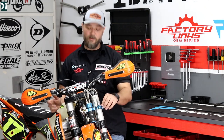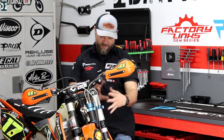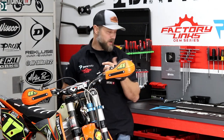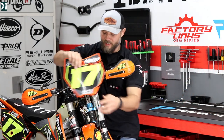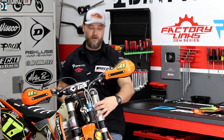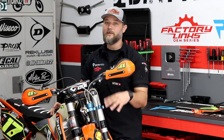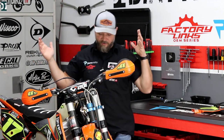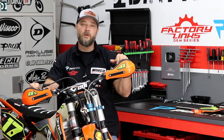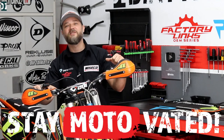As I said, I would have to grind part of the bracket because it was hitting my radiator, so the fitting needs adjustment if you want to run a headlight with extra accessories. But if you're running XC with just the number plate — no headlight — there's pretty much no headache at all. You install it, position it up or down, and it's not touching anything it shouldn't. Share your comments below, let me know if you have any questions, and whatever you do, stay motivated!